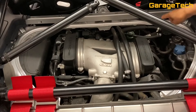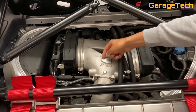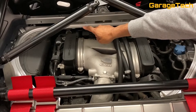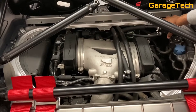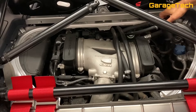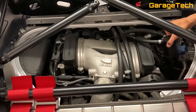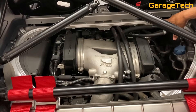So I'm just going to put you up and let's take a look. As I said, if you remember, I've fitted my catch tank up over here, so obviously it runs off down underneath the plenum chamber up into the original air oil separator, which I replaced. So I've replaced that and then fitted this oil catch tank. I've done 1,000 miles now, so I want to open this up and have a look to see how much oil has actually been collected. I haven't opened this up yet, so it'll be new to me as I open it.